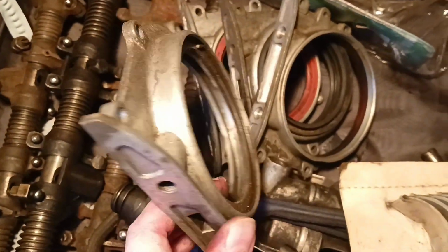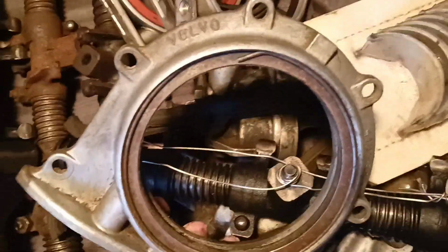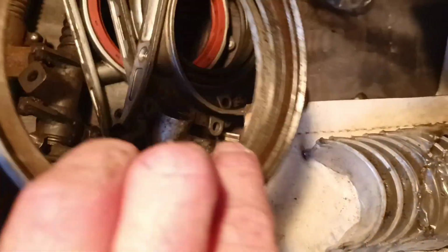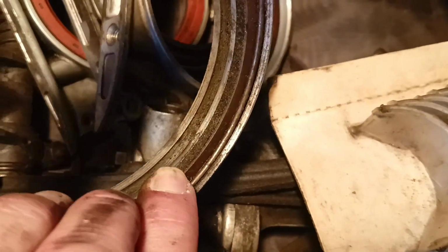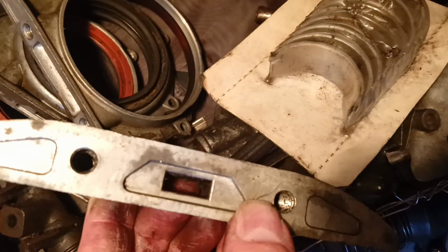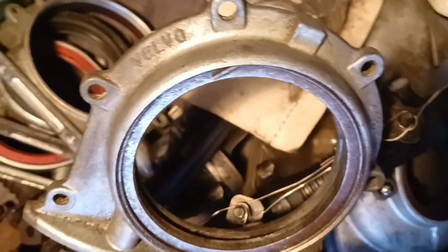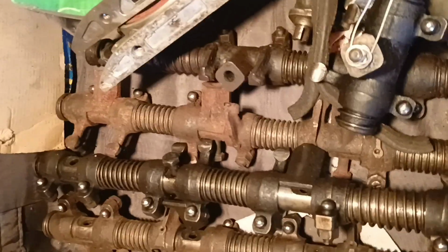the best condition ones from them. Here is, by the way, for filtering. Here is a stopper washer for this felt. You see, here is the old type of seal made out of felt. But I prefer using rubber rings, rubber seals, I mean. And here is the way oil goes to the sump from the felt.